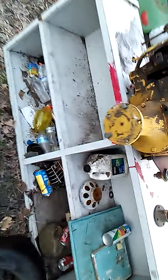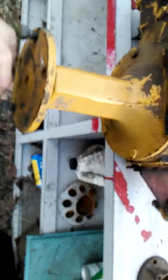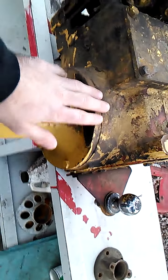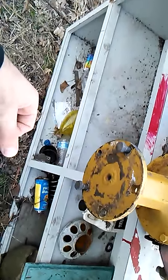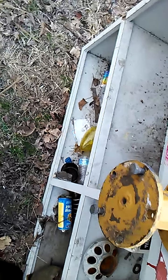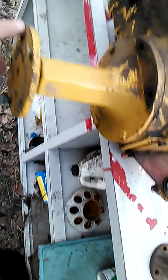Here's what I'm planning on doing. I plan on grinding all this right here flush to that piece right there, then I'm going to put a universal here, then put this back on, put a universal on both sides, and then we're going to have another universal — like a 1 inch solid rod that goes down to another universal. Then I have all that room for swing or flex.